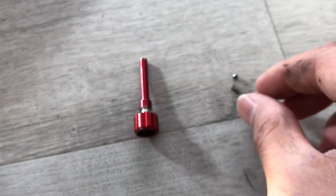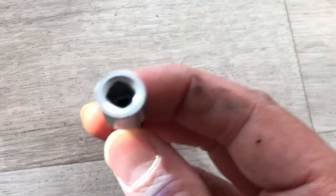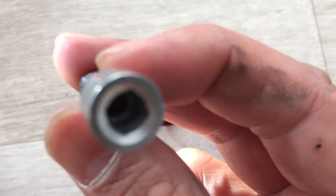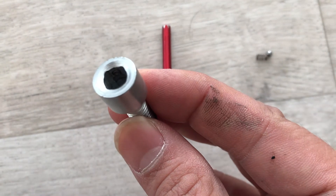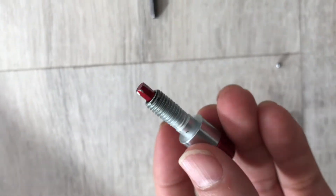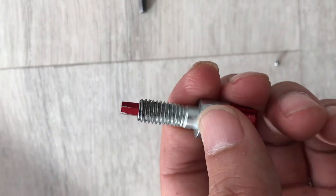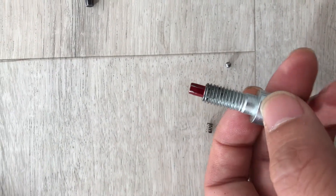All it really was is just a 4mm hex wrench. It comes with a spring and a ball to kind of lock it into place, and it goes into this hollowed out screw — there are grooves there so when that ball hits those specific grooves it makes that clicking sound. The knob inserts into the screw and at the very end is that 4mm wrench sticking out for you to adjust your rebound.